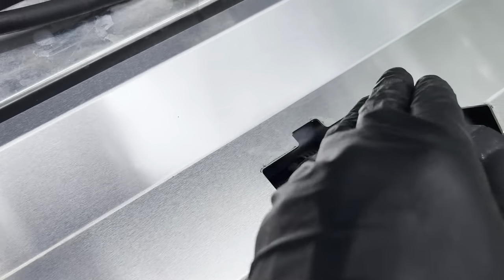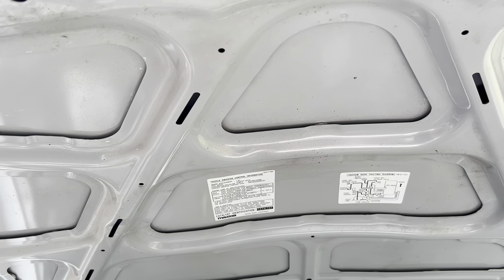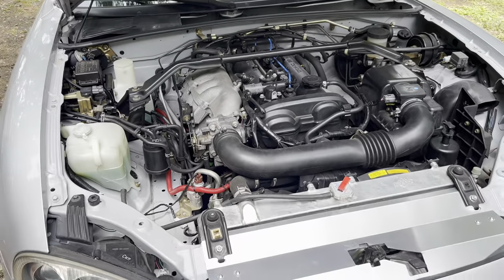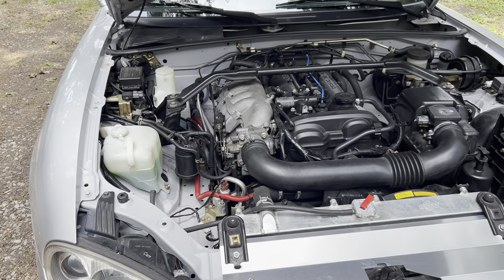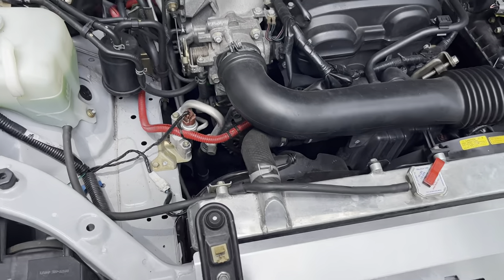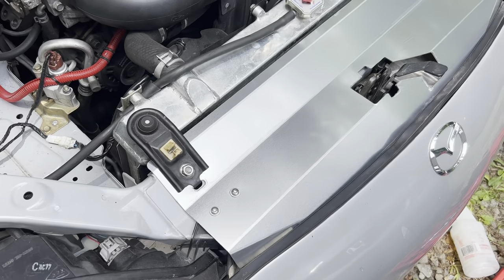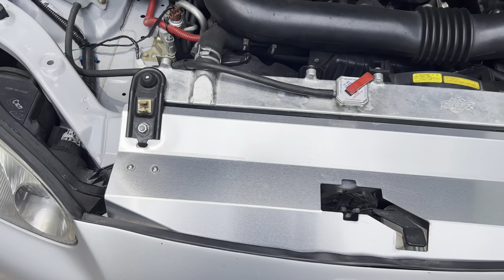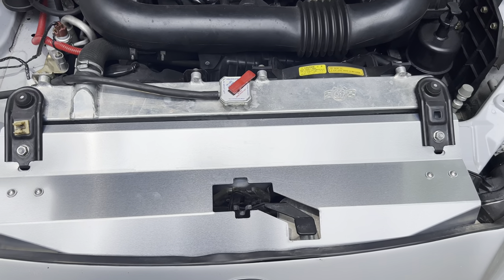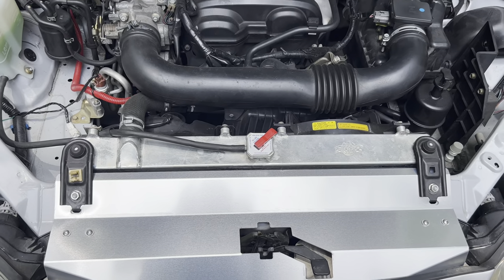All the holes are covered and the air underneath will go straight through and not above, so it's a little more closed off. Next thing to do is cut the hood vent, and I'll be doing that at some point soon to see how she does on the track temp-wise. I get about four or five hard laps in and the alarms start going at 260 degrees oil temp, so I'll probably need a cooler eventually. But for now let's see what heat extraction and airflow does. Overall really like this — 80 to 90 bucks, it's simple, and just one more thing you can do to help with airflow. Thanks for watching and I will report back.